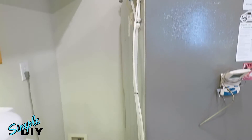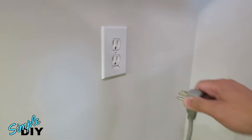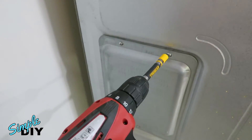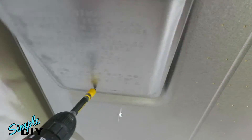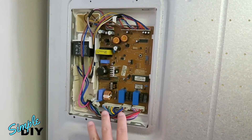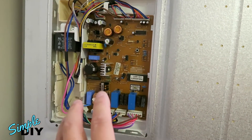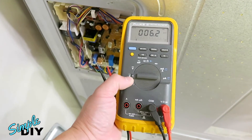Here you can see I've pulled the fridge forward. Next, disconnect the power cable. Looking at the back of the fridge, there's an access panel right here — go ahead and remove the three Phillips screws. Here's a look at the main controller board, and you'll notice there's a switch you can press which will allow the fridge to go into test mode. You'll also need a multimeter set to AC voltage measurement.